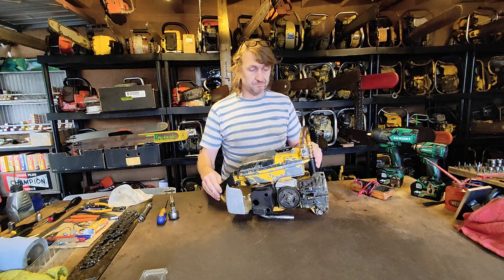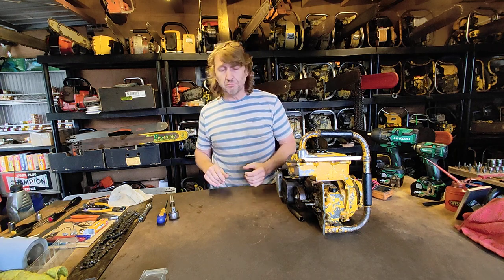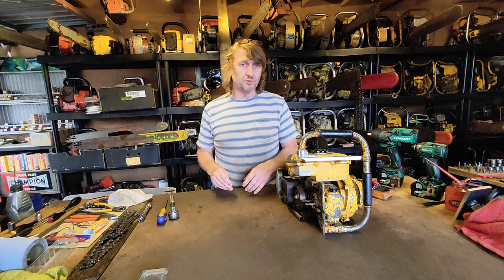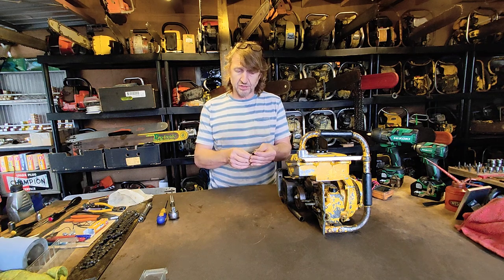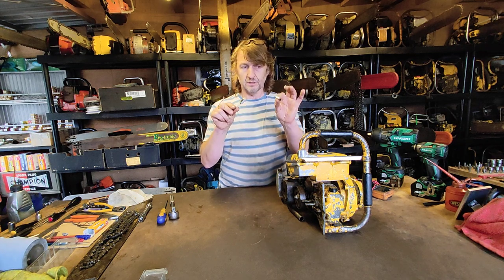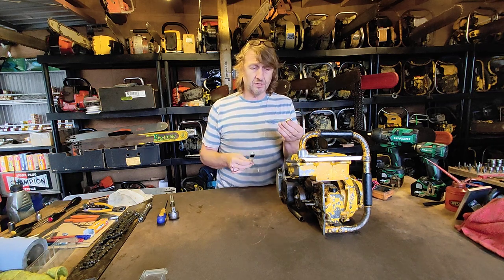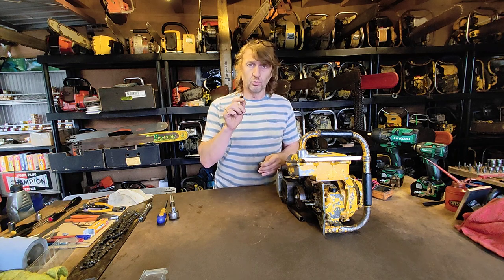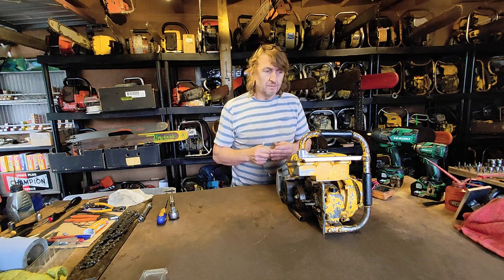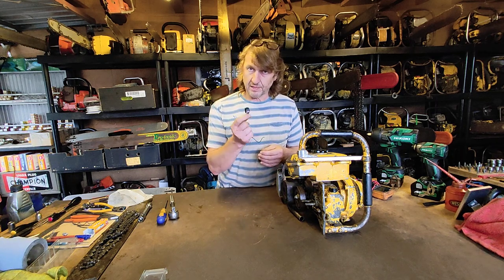And have I jumped two stages? Possibly. Two incredible pieces of test equipment you might find are invaluable to have. And even if you don't agree with wanting to fit them afterwards, I have found them to be such a handy workshop aid. They are little switching modules or transistor modules which replace points and condensers on old engines. Now, they don't work on all engines, and again, it's going to be some empirical knowledge and some trial and error if you have particularly old engines and you're unable to replace certain points and condensers. But they have another fantastic function.